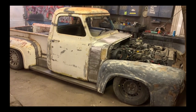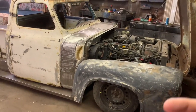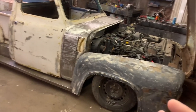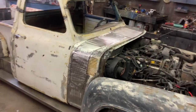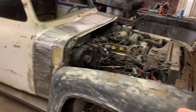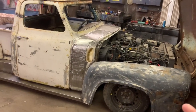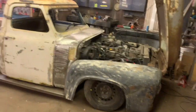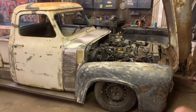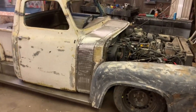I've probably used 10 or 15 of these as a donor chassis and never had this issue before. Turns out it is the security system. A big thing with these security systems is the PCM will go bad — they go bad when you weld. Every time I've ever welded on anything I always unplug the battery, both positive and negative, but from what I've read, freak accidents can happen, especially if you're welding anywhere near the PCM or ECU. Sometimes it can still cause issues even if it's not plugged in.